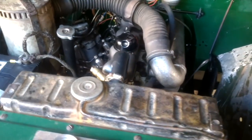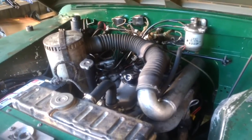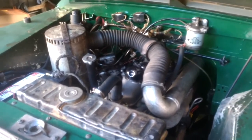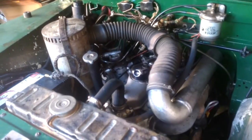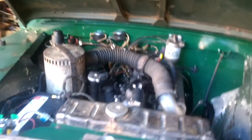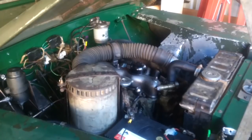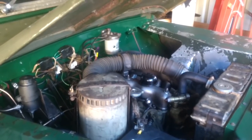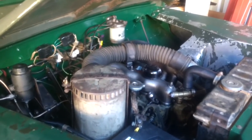A little bit of TLC and maintenance here and there, but I think we're getting very close now. I've done exactly the same process with my 300TDI Discovery 1, where I've replaced the front fuel filter — it's a different type, a screw-on one almost like an oil filter. I'm yet to do the sedimentor on the rear of it, which will be pretty much the same as this one: just pull it apart completely, clean it, and put it back together with new O-rings. I'll keep the updates coming as I get parts. If you've got any questions, put them in the comments — I'm happy to respond. Until next time, thanks for watching.